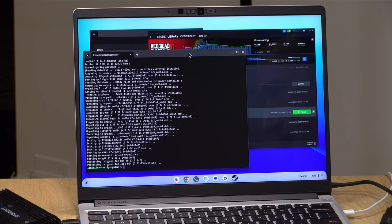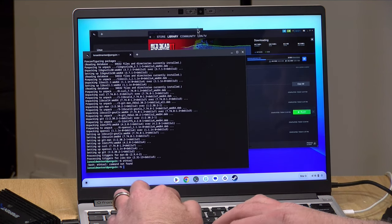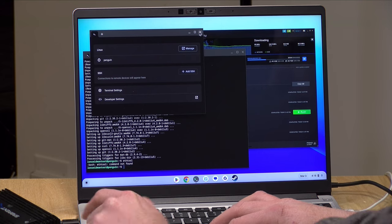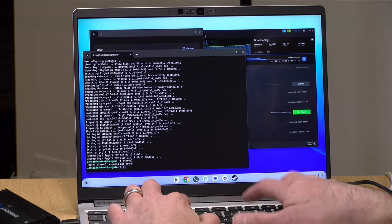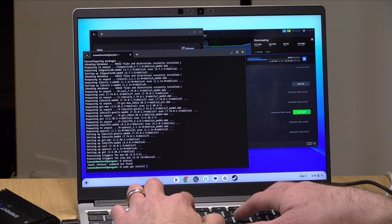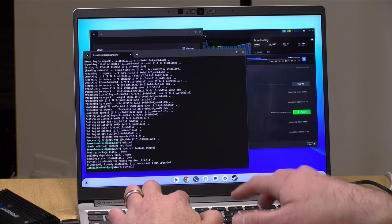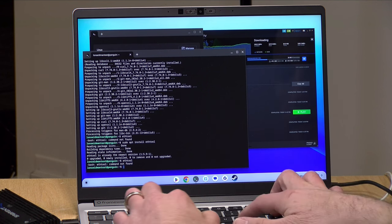So we're trying to just see if we can figure out what link speed we're connecting at. So I'm just trying to get a sense as to whether or not we're getting, I think we're getting about 2.5 gigabits, even though I'm connected to a 10 gig adapter. So it says it's on here, but it doesn't actually run. So they must have it buried somewhere in the app is the thing to use. Okay, I'll try that. ip a.